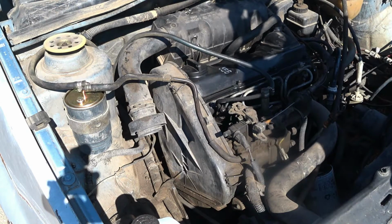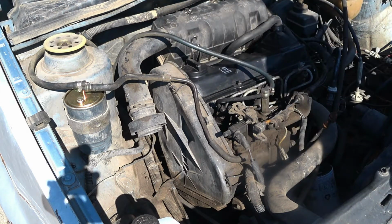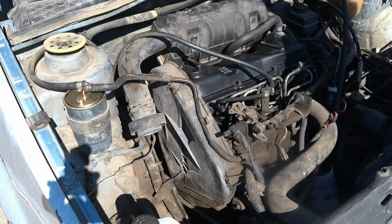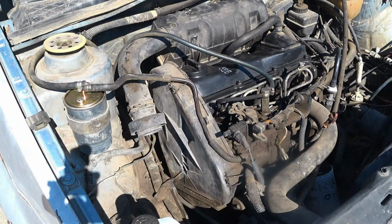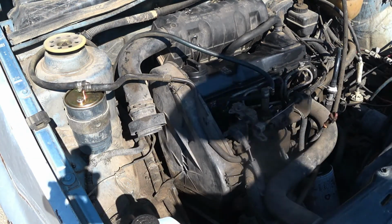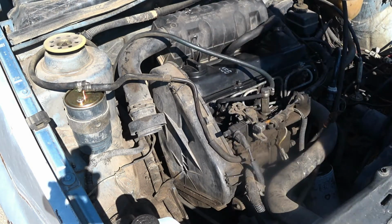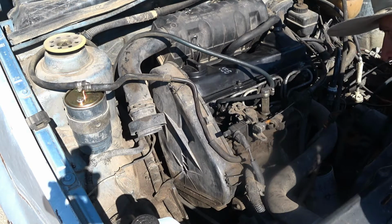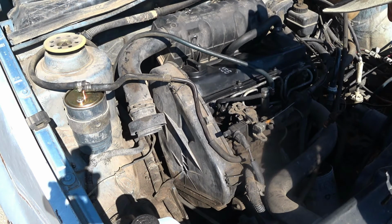So I'm going to go ahead and turn on the ignition at this time and look for fuel leaks, since we got a big bright sunshine light shining on our engine. So you can hear our lift pump. It actually sounds like a bad speaker, and we're looking good over here so far.